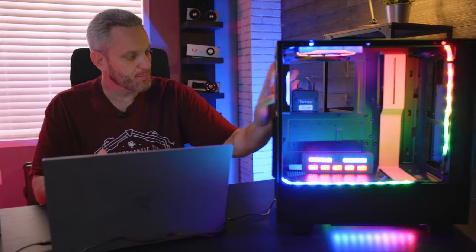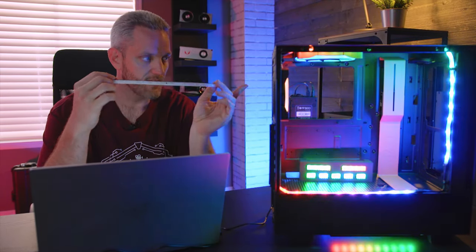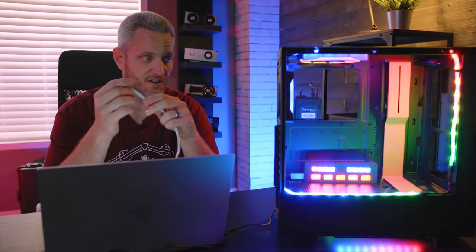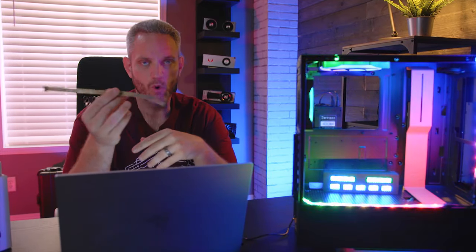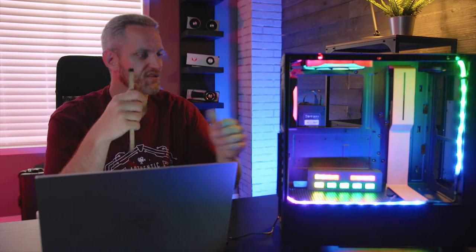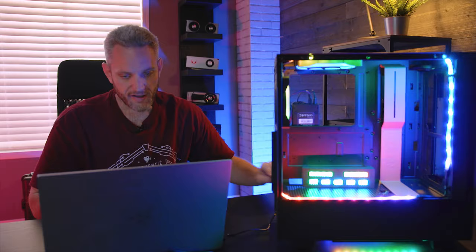There are some game profiles that can be controlled by the NZXT hue — for example, bomb defusing in CS:GO would cause all your lights to start flashing red so you knew a bomb was planted. It's pretty neat. If you want to learn more, there's a link in the description below. The best part is it's removable and can go into any of your systems. The hue 2 control box supports four strips per header with four headers total, so you could have up to 16 strips on a single box. You can also have more than one box in your system as long as you have enough USB headers — we ran one daisy chain of three strips, one underglow, our lights, and our cable combs all hooked up to a single box.